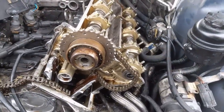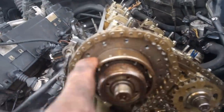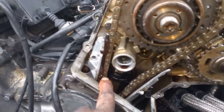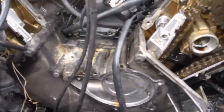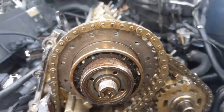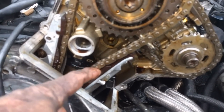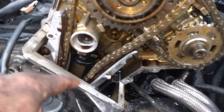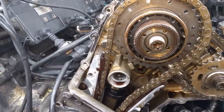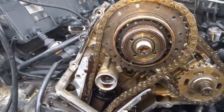I have my chain half on. Once you're ready, lay the chain up here and then take your tie wire off. Make sure your chain is in the track here and in the track on the other side - you should have enough slack to work the chain around and get it on there. I start from here and work around. It takes a little bit of patience and be careful making sure your chain is in the groove. You don't want to damage your chain guides, so don't force anything. It's one of those things where you just take some patience and working.